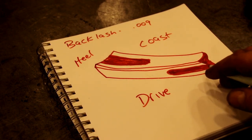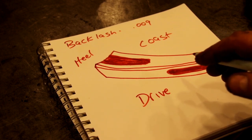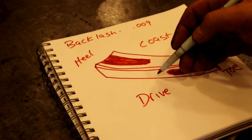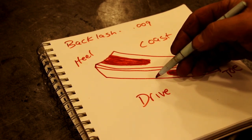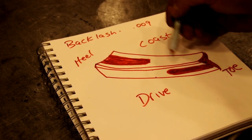And this is what we got for, I know it was hard to see, I couldn't get you in there, and they didn't have the real good marking compound anyway. That would have made a lot crisper pattern that you could see. But what you want, by setting the pinion correctly, is you want your tooth to hit centered in the surface there. You want a little space top and bottom.